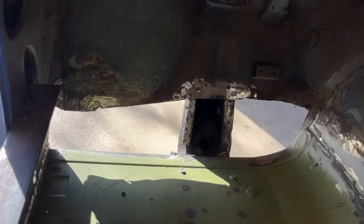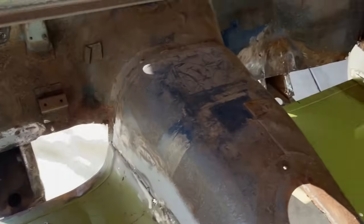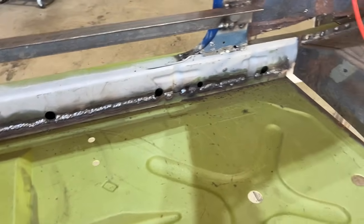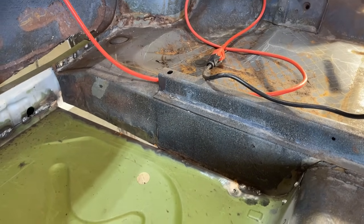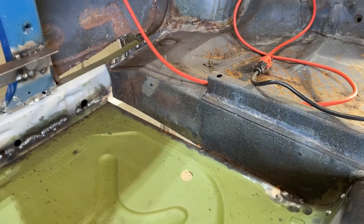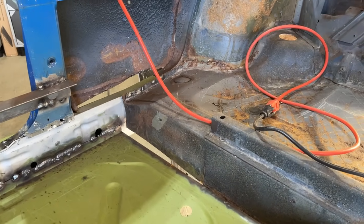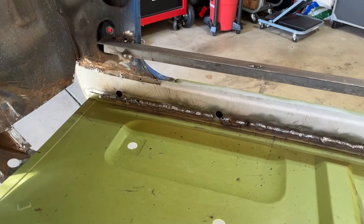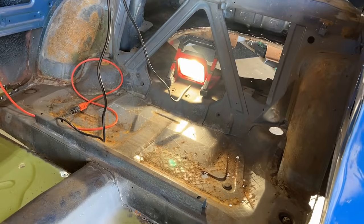When I have better metal, my welds are a little bit better than on the thinner stuff. I've got this to fabricate, which I'm actually enjoying. On this side over here, you can see the welds are a little bit better - they're just tacked in. I need to make sure I get some strong angle iron metal on the back of that. I'm going to take a 16-gauge and bend it up, because the roll bar box sits in that corner and I need to make sure that part of the car is strong. Eventually we'll have to cut through the firewall to get the ones that go up to the strut towers in the front.